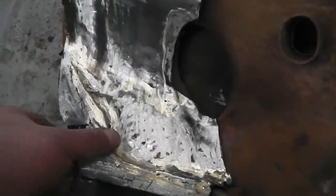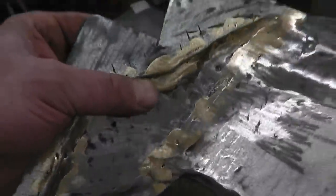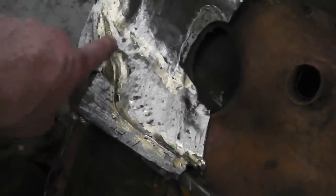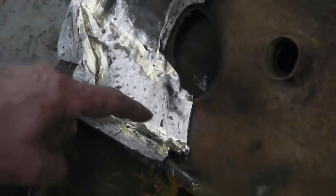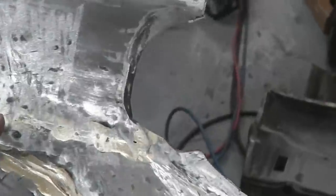Here we go. This one was a little bit harder. It's got more shape to it than that side in terms of this inner lip, which we had to make. But we got it in the end, it fits in quite nice. That lip there, I did it like a ribbon, a separate strip of steel, went vertical, tacked it, and lost the tacks and infilled with braze for this one. That's nice and waterproof. I've checked it with a torch, can't see any pinholes in that. Fits in nice, and it actually goes on the car as well.